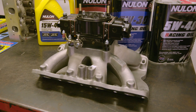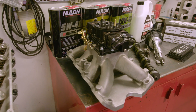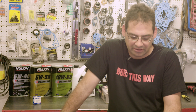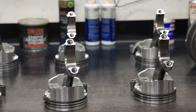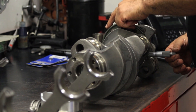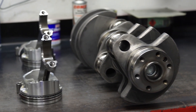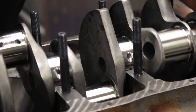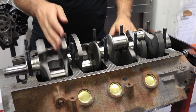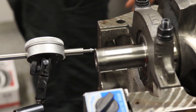The intake manifold is a CHI 3V, made to fit the 208 cylinder head we're using — a single-plane intake that's great for the RPM range we're working with. Everything we buy goes through a quality control process: we check all the rods for length, straightness, and size, and check all the crankshaft pins to make sure they're within tolerance. This engine has been internally balanced, and as you can see from the counterweight, we've barely had to drill it, so without that external mass on the front and rear it'll make the crankshaft last longer and keep the engine more stable at higher revs. Unfortunately, that does make the build process more expensive — there's potentially 10 or 12 hours spent just checking everything out.